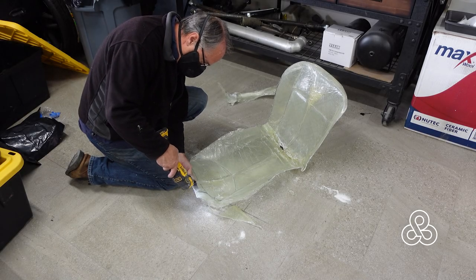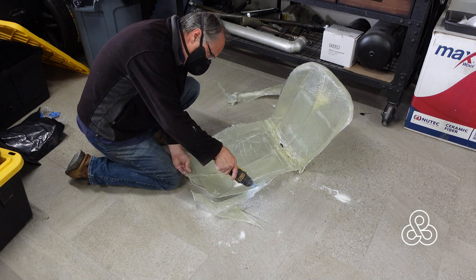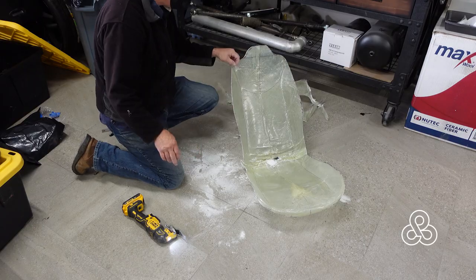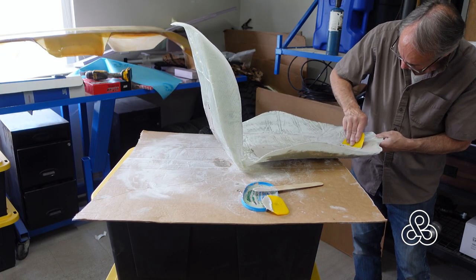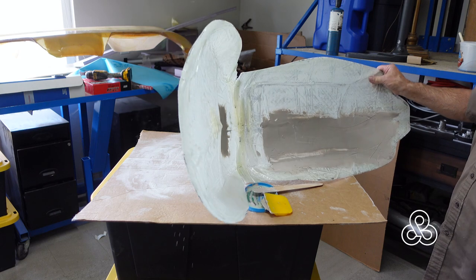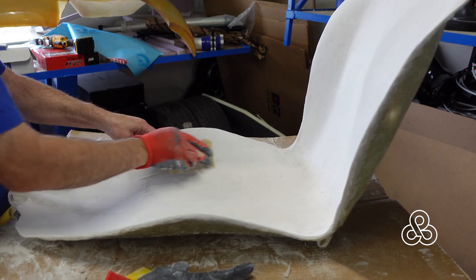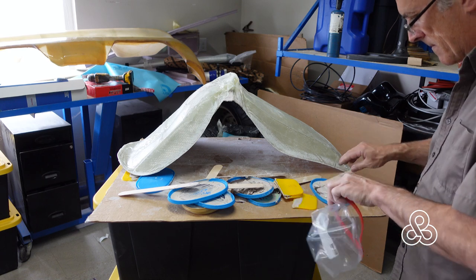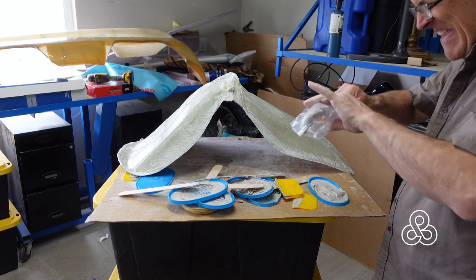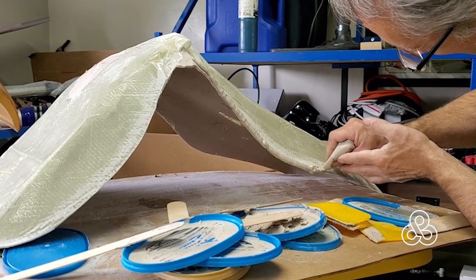Well, it came out as good as could be expected. A little rough, but that's all we need — just the basic shape. So we're going to get it trimmed up and start doing some finishing on it to turn it into a fine custom seat. And there it is. The first thing we have to do is fill in the lots of wrinkles from the polyethylene bag using body filler, squeegee that in there, then get in and start sanding that to get a better surface finish. It's also kind of a basic generic shape, so we're going to start adding some features. First thing is to load some body filler into an old Ziploc bag, cut the end off, and kind of build up the edges to get a nice round rolled edge rather than that sharp edge of the fiberglass.